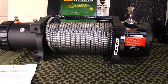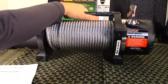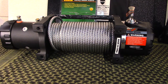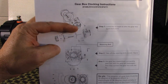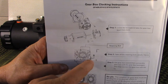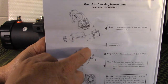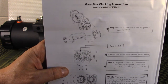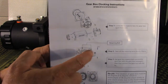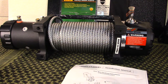There are two bolts you remove on this side and then you can pull the gear cover completely off — that's where your gears are. Once you do that you'll see this piece here. There are 10 retaining bolts holding it on. You take those off, rotate it where you want, then reseat and replace the bolts. It can only be rotated in 36-degree increments clockwise or counter-clockwise because the holes must line up.